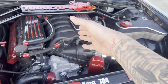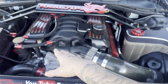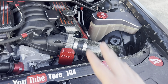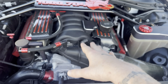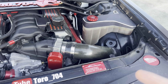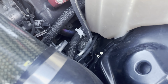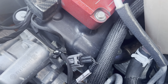Third, you can get a ported intake manifold. You can send your stock one to MMX or buy a pre-ported stock 392 intake manifold for around $400 — sometimes a little less if you send your own. There are also options like Edelbrock that some friends run. Those are the three I'd go for — they're very cheap, fairly easy to obtain, and you can put them on yourself.